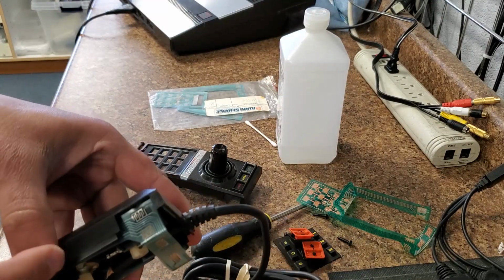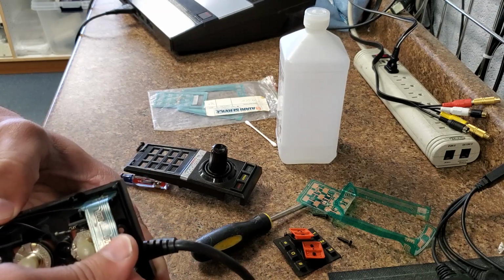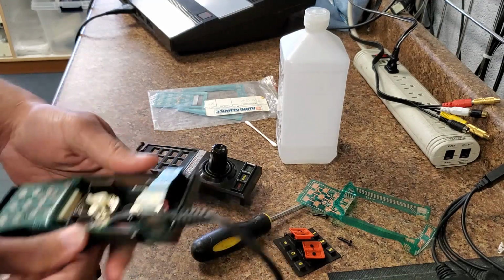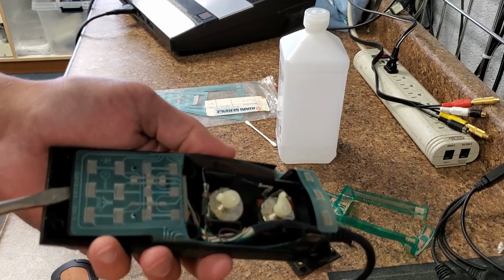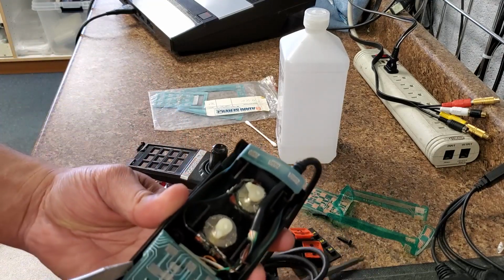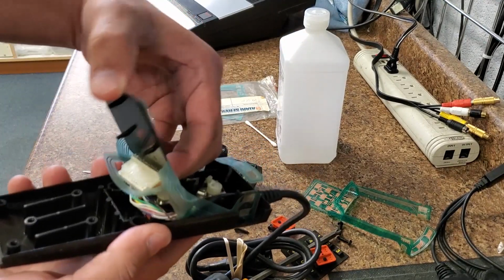And you can examine it while it's apart. This one was being fussy. The start button wasn't working very well without pushing very hard. Alright, so now for the big flathead screwdriver. What you're going to do is, the piece underneath this has 3 little pins. So you're going to pop, pop, and pop, and I'll remove that up. Okay? And that's what the flex circuit sits on.